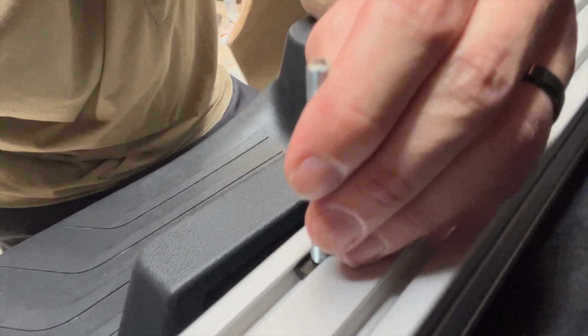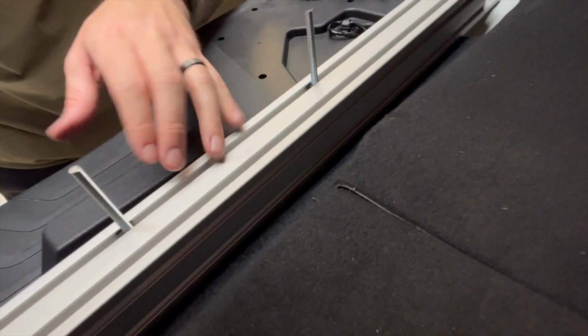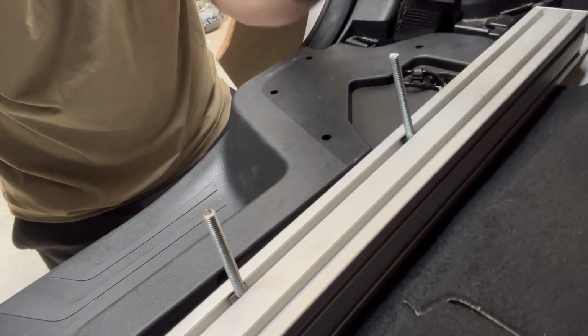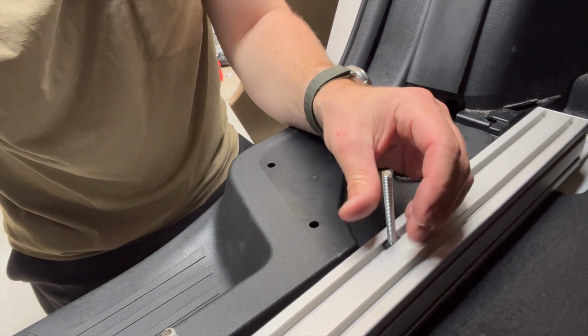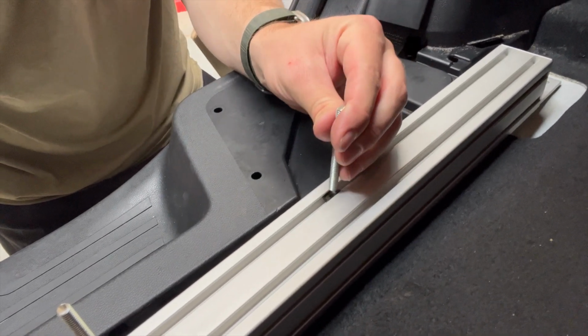So here's how it works. Essentially, I find my T-nut and screw that in, a little bit loose there, and make sure I've got the right end here on this one. And now when I lay the board down, I'm going to pre-drill holes, remember, in the birch. I've got these nice locators that I can just move around, drop the board right on top of in here, and then once it's aligned, I can remove these very carefully, right? And then I'll have a T-nut ready to receive the correct bolt, not this one.